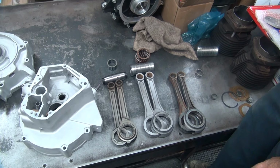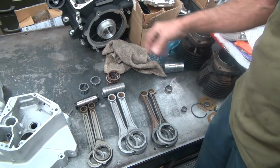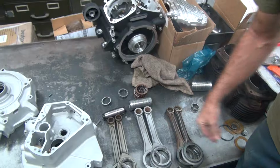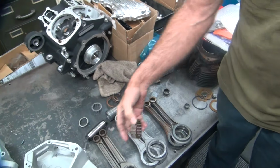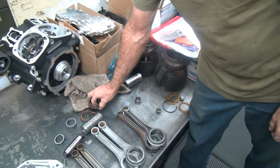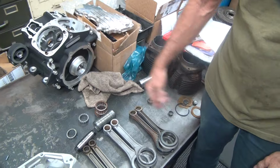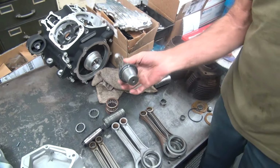Instead of using the pinion bearings that look like this, they put a big roller in there, a Torrington roller that's like this but bigger. Oh, okay. Slip-in roller would be more like one of these. Slips in the case. They got rid of that. They went to a bigger bearing. So they upped the bearing size and all that on the main bearing also. They still use the Timken on the other side where it belongs. Timken's good. This part of the motor's good.